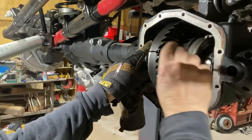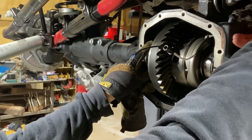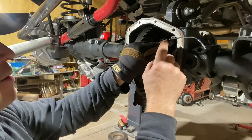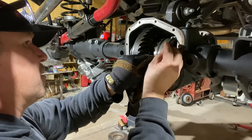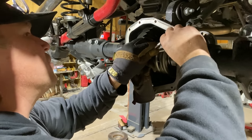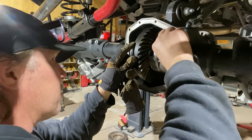This is all in. This is the wire that needs to go through the housing. We drilled a hole through the back right underneath this vent. So this wire, and there's a grommet right there that will seal it. And so we need to feed these wires through that hole and then press the grommet in, but do it in such a way that you can still get this cap on.